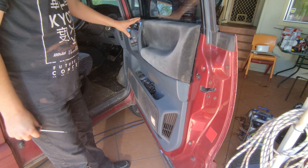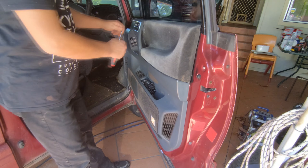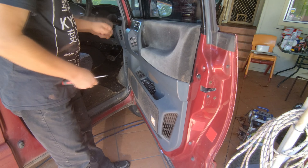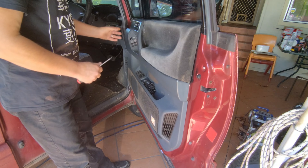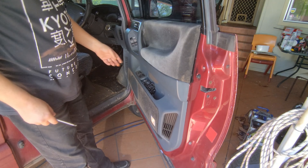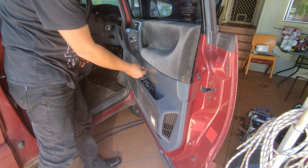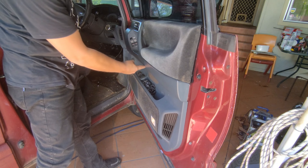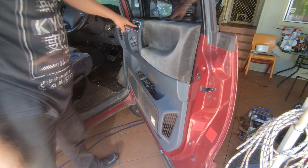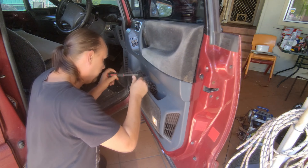For starters, I've got power windows, so for me this part here is easy. If you've got a manual door handle, you're going to use a cloth to get that off so you can take the handle away. But for me that's going to stay in. All I need to do is remove this top cover - I don't need to remove the bottom one. I've removed this piece here to reveal the screw that's behind, and another screw up here that needs to be removed. For me that's it to get that top cover off.